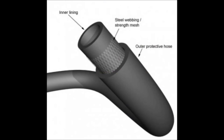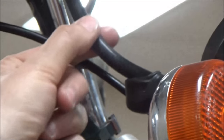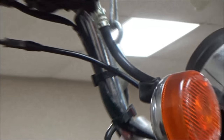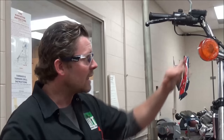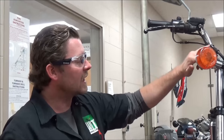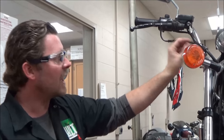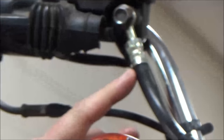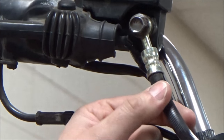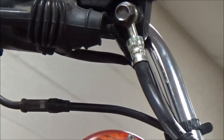You'd see braided strands inside that give the brake line its strength. We've had hydraulic brake systems for a long time — 20 years plus. When this is made, we take this rubber reinforced line and crimp a metal banjo around it. That's a weak point where, over time especially as it moves around, it can crack or deteriorate.